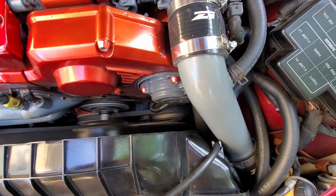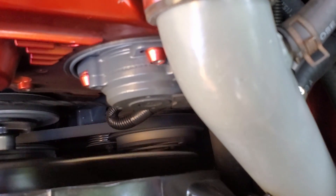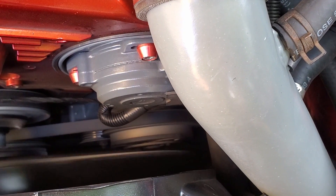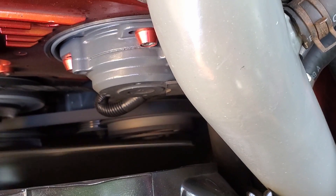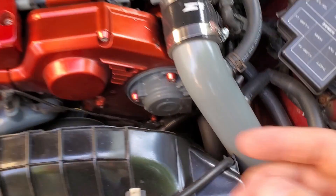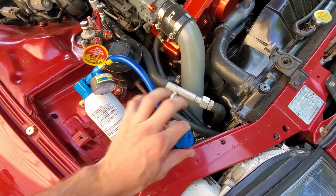Make sure the doors are open so the cold air is not recycling. Now focus on the compressor — that piece down there. Make sure each component of the compressor is moving: you can see the belt is driving and the metal clutch component right under the belt is also spinning, which means the compressor is actually working. Now all we need to do is connect our refrigerant.